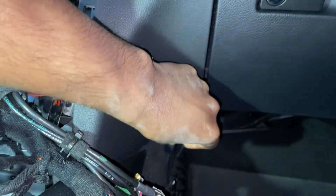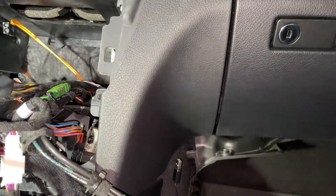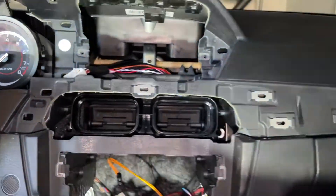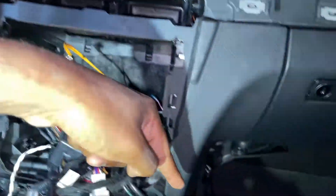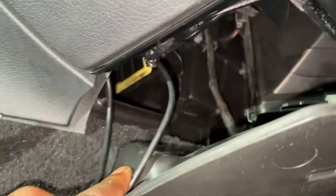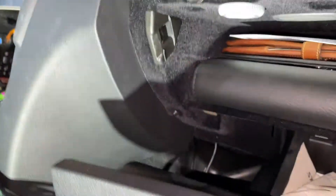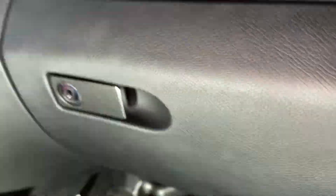This is my CarPlay adapter — I'll make a separate video about it. Using my rubber tube, I run the cables down this way and out over there. Just by feeling around and following the wires from up there, I was able to get these two USB ports to come out over here. We can leave these sticking out to plug into the CarPlay box, or we can open the glove box, slide the cables in here, and it should be able to close without a problem at all.